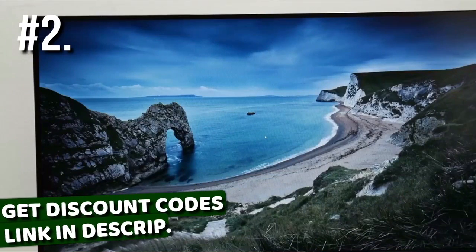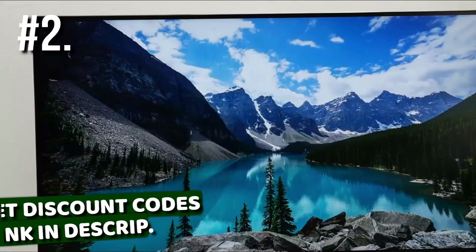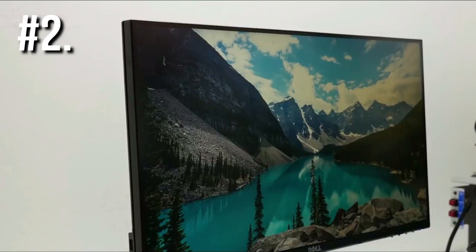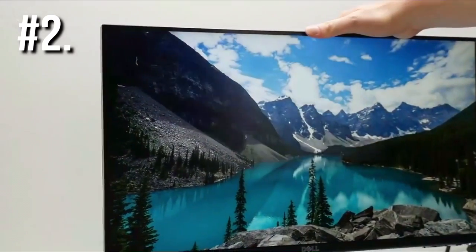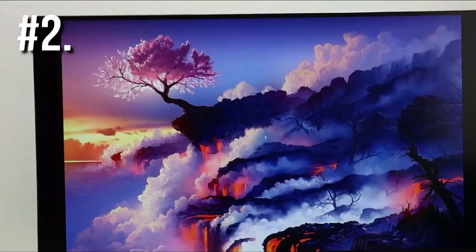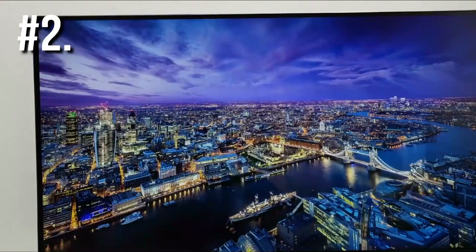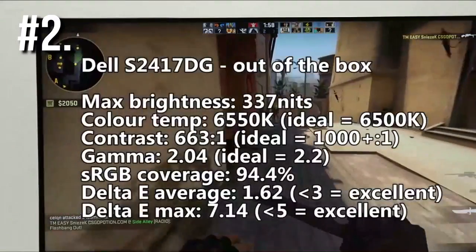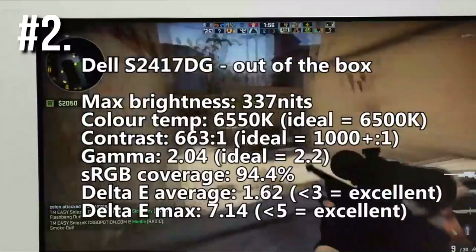When it comes to image quality, this display largely gets things right. Being a TN panel, viewing angles aren't its strong suit, but it's far from the worst, and so long as you don't go to extreme angles, it's okay. As for colour reproduction, the use of a proper 8-bit panel rather than 6-bit with dithering has paid dividends, as the image is noticeably more stable and accurate. What's more, right out of the box, many aspects of its image quality are in fact excellent.